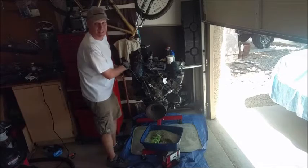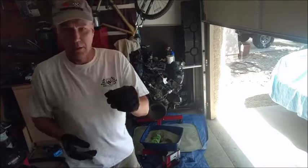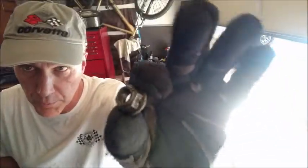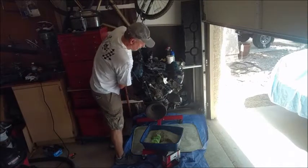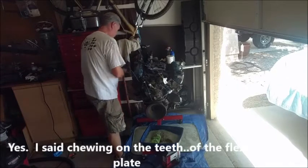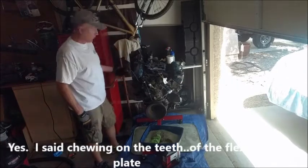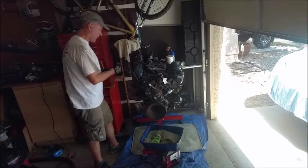It's been clearly just taken out of the car so many times that they were kind of straight back. I don't know if you can see how good those look, but that's pretty well worn — and that's probably the best one. So we're going to have to replace those. I'm looking at the flex plate, and it kind of looks like those have a little bit of chewing on the teeth, so I'll probably just try to replace that too.